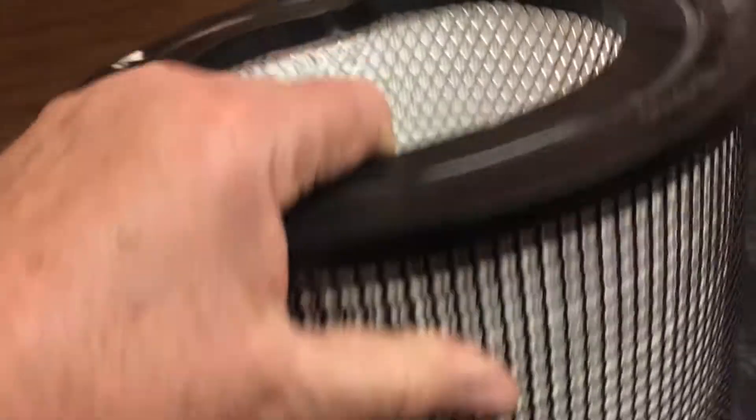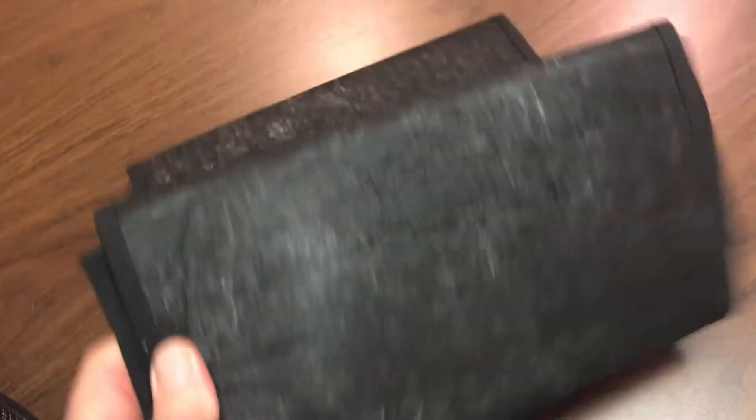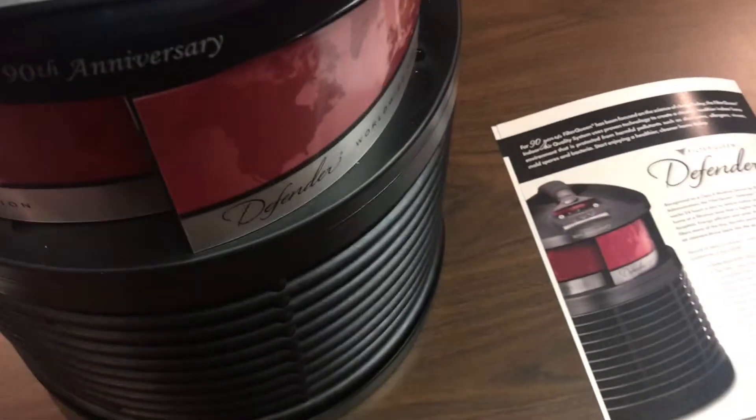The reason it does that is because of the main filter — it's a high-density parchment-based filter, good for about a year of full running time. It is also wrapped around with an activated charcoal filter that velcros around the main cartridge and adds a layer of protection. So it sanitizes, deodorizes, and filters the air as it runs.